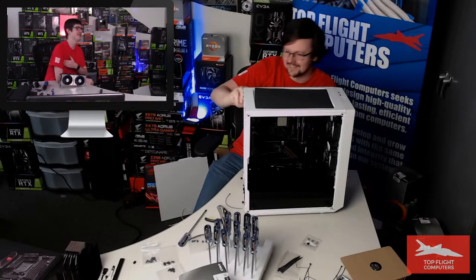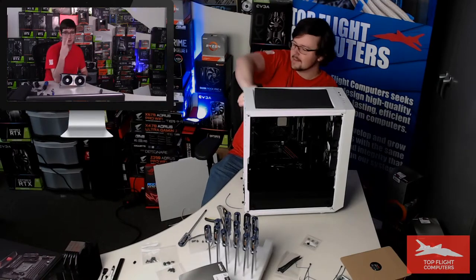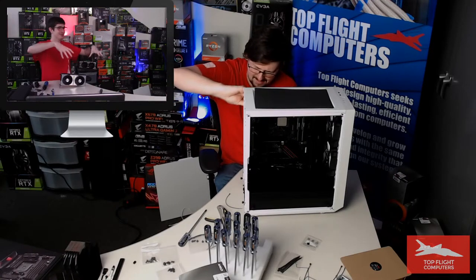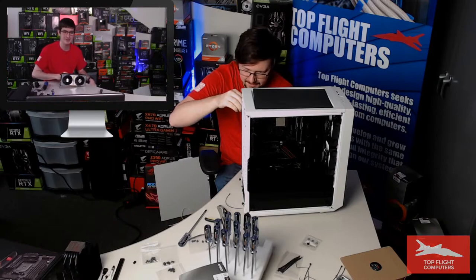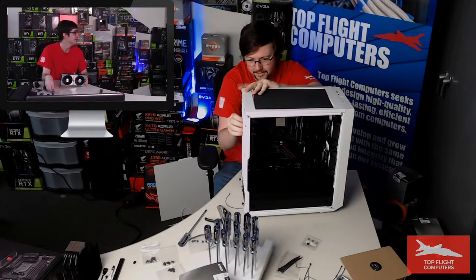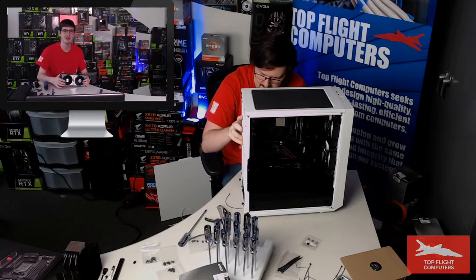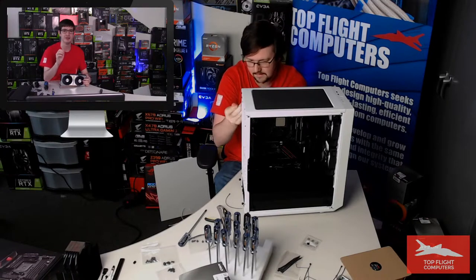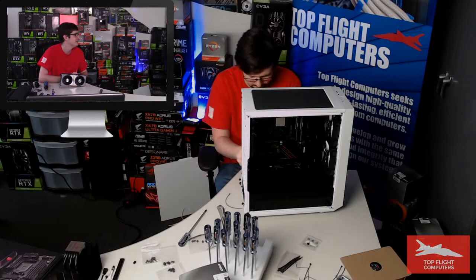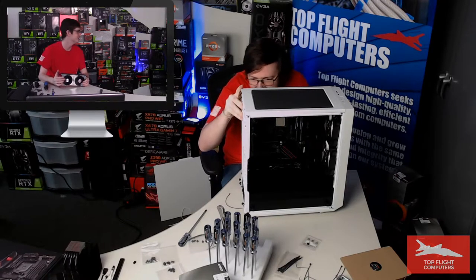I still think about that video where Linus had 8180 Platinums. These are $10,000 CPUs, and he had two of them in the board. He didn't have a cooler, so he pressure mounted them. He had a block of metal in one and something in the other, pushing them into the socket. I remember that. It was so bad. Well, yeah, because there wasn't actually any mounting for them, since the coolers mount them to the motherboards. With any CPU, but especially the LGA land grid array sockets that Intel uses, there has to be pressure on the chip for the computer to work at all, because otherwise the pins and pads aren't making contact correctly. So that's sketchy. It makes me nervous to watch. Like $20,000 of CPUs, you just hold them in there.